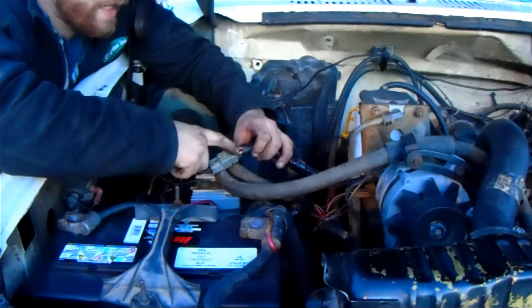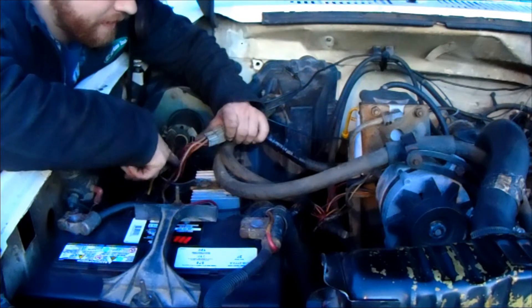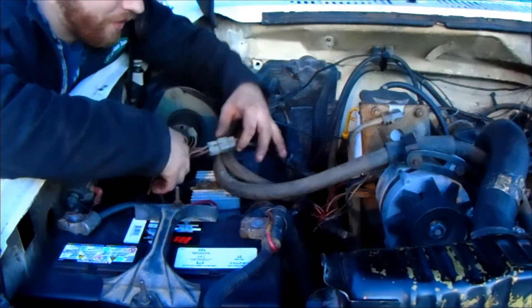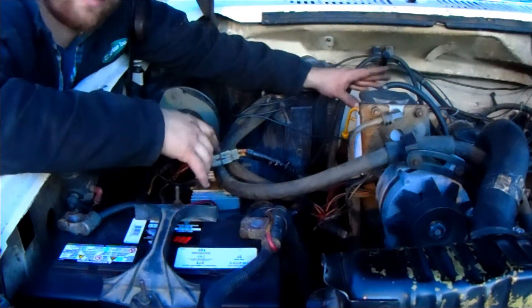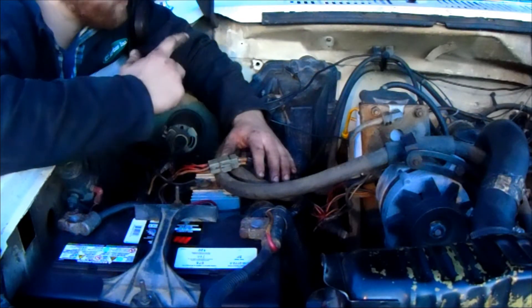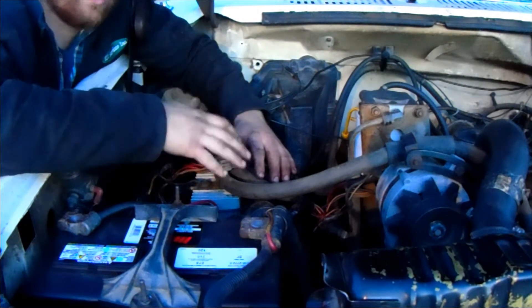On my harness I have a big yellow and a big orange going to my glow plug controller — those are my main powers. On the 6.9 harness it's two thick wires, maybe beige or orange — they're like 8 or 10 gauge and you've got two of them. Wire those in together. Once you have your controller over there with all your grounds set up, you'll be left with a few extra wires. On mine I had my wait-to-start light wire, my coolant heat light, and my coolant temperature sweep gauge.